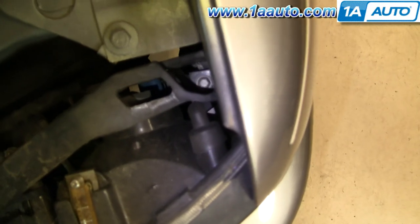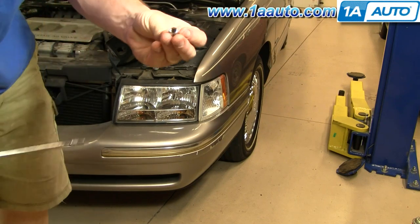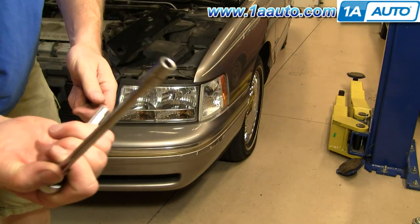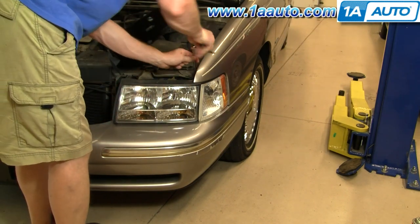Right down there, I'm going to remove this bolt. Technically the right tool is an E8 star bit, but you can actually use a 7mm socket that more people have in their toolbox.